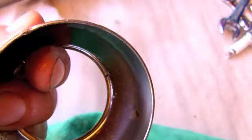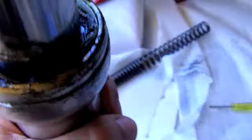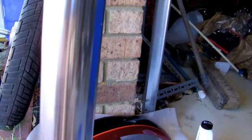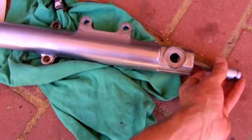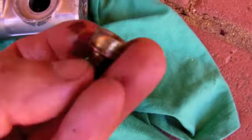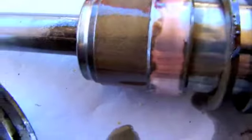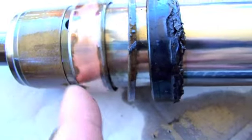You've got a fine grade there. That's how you get the dust caps off — just pry them off with a big screwdriver. Dust caps are easy enough to pull off. It goes underneath the dust cover, and then you've got your spring clip. You can go clockwise and anticlockwise and just pull it out at four points. The bottom of the fork comes out pretty easily. Some guys reckon you need an air impact wrench but I've never really had to use one. Don't forget to replace that washer with a new one. The bushes look a little bit worn but there was no slop in the fork so I'm going to reuse those until next time.